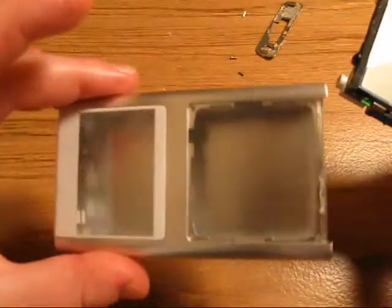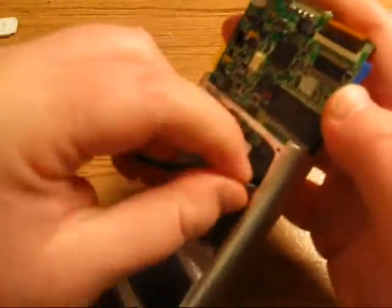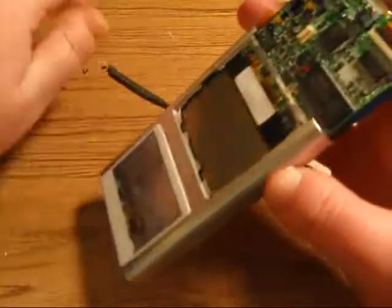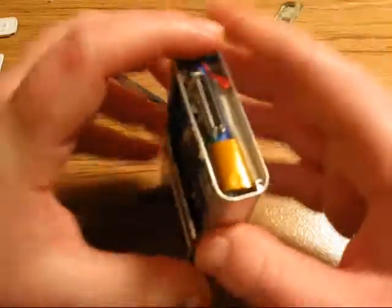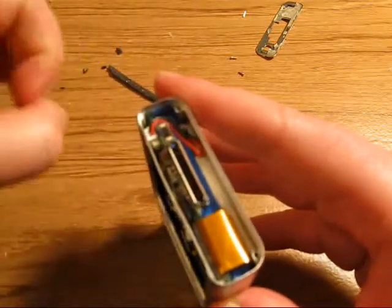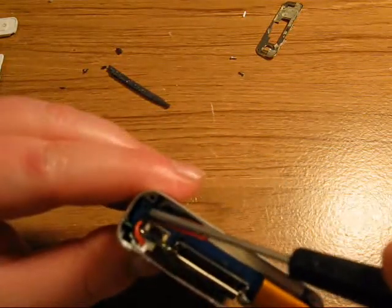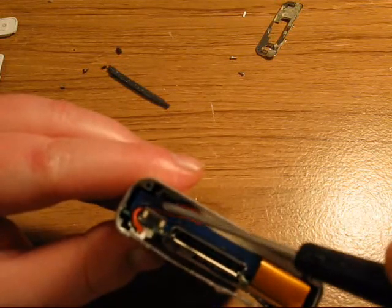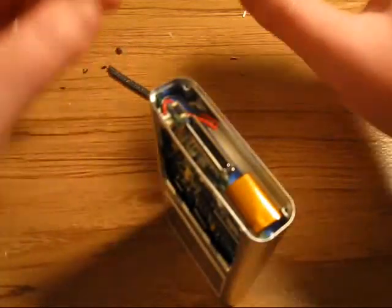And now we're going to put the whole thing back into the aluminum case. Put it in like this — you might need to make some adjustments on the way in because it's kind of a tight fit, and sometimes it just does not want to go in there. You might need to press down on the screen a little bit as you push it in. Make sure the battery goes down enough and push it in with your fingers. Make sure that these cords here — the black and red cords — are out of the way of this reset button. You do not want the cords to be on top of your reset button.